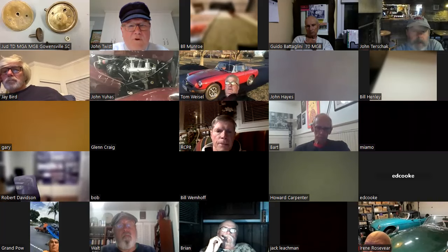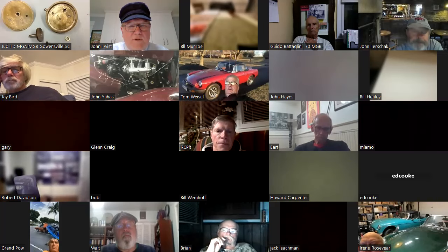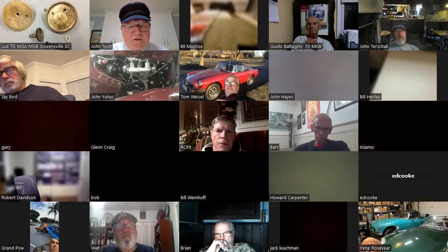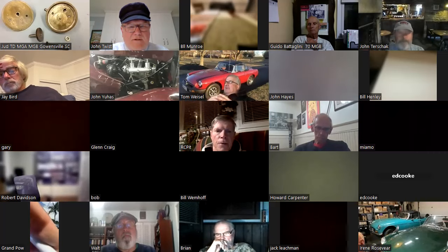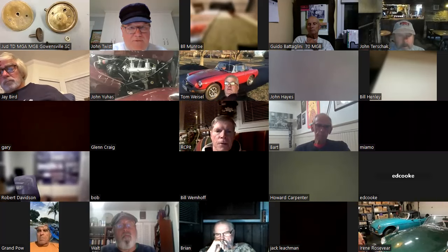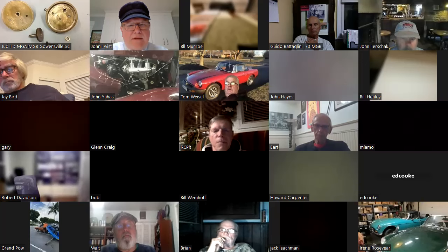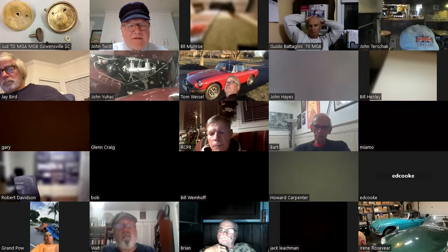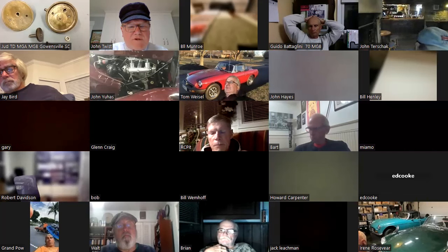They have a form. Morris at West Valley Instruments has a form he'll send to you. He wants you to push it through a certain distance and check the turns of the speedo cable. I always do that three times and then average them. Gets it more accurate. And from that, then they'll calculate what the gears are to run the odometer correctly, and then they can set up the speedo so that that works correctly too.